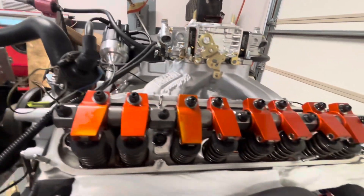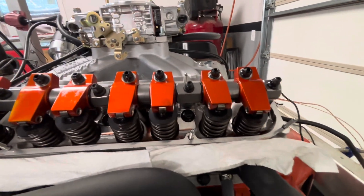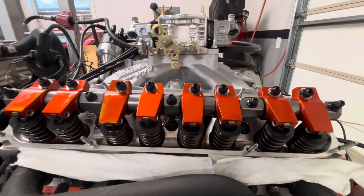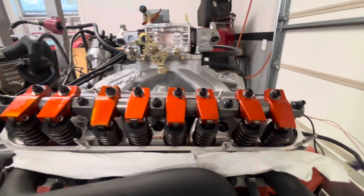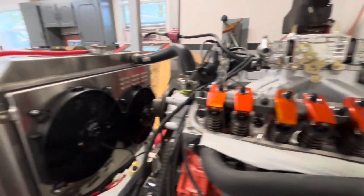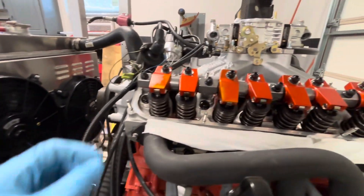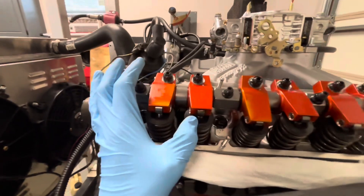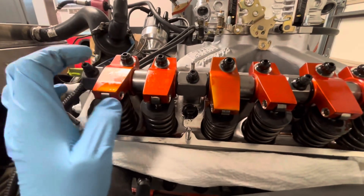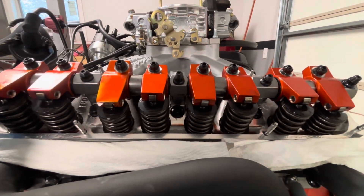It's got a little bit of rattle to it, and I've heard people mention that before. There's nothing wrong with the build — it's just a noisy aspect of what they are, a defining characteristic of that lifter. They're supposed to be good to 6,500 RPM, and some viewers have mentioned they run them in their race car and love them. So we're going to go with them and keep pushing forward. I bumped it over with a key to get to the rollers, and it's got a little bit of assembly lube left on there, but nothing's burned or burnished.